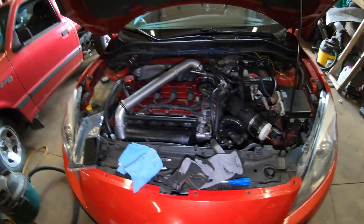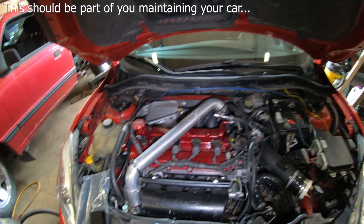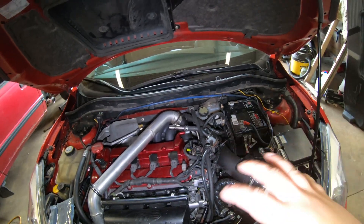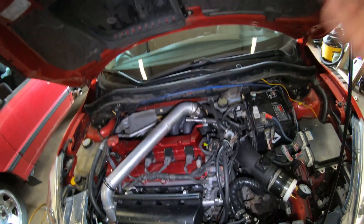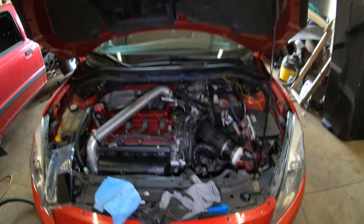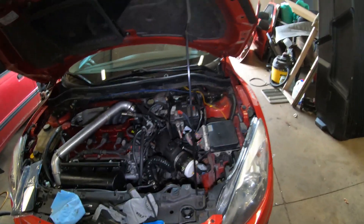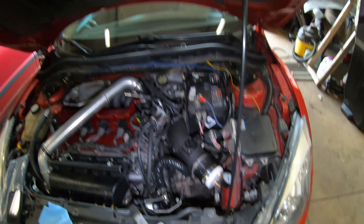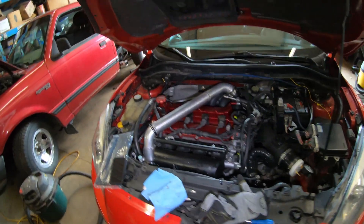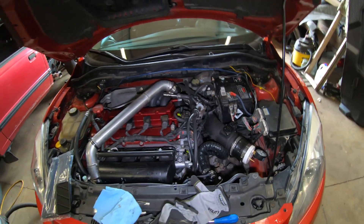For me this is going to be spring prep every year now that I've built the boost leak tester. Anytime you blow off a charge pipe and put it back, it's a good idea to do a quick boost leak test — to confirm the pipe isn't going to pop again and that nothing else is leaking. You don't need anything crazy — a small 1 or 5 gallon compressor works just fine. A smaller compressor will just run longer and be louder, but it's not a big deal. That's it for the boost leak test video.